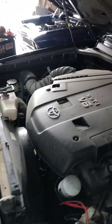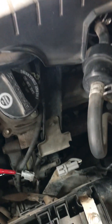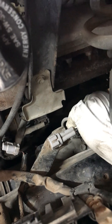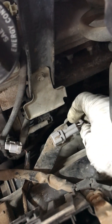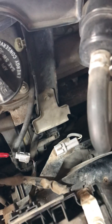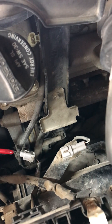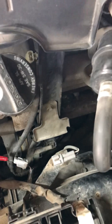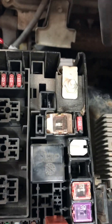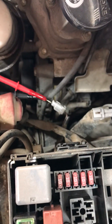And this is what we find out. We already checked — we already explained it in the other video — we already checked the wire, the cable that connects here to this plug. This cable right here goes down into the left side speed sensor, which is the one that's not working. And we don't have any problem with the wire or the sensor. The problem was more internal — like we explained before, it could be the ECM or the ABS module. But this is what we find out when we were searching the wire harness, because this is one of the first things you want to do before you start changing any parts — and this is what we find out when we were looking right next to the fuse box.